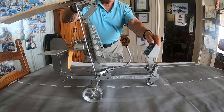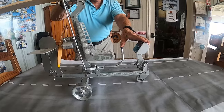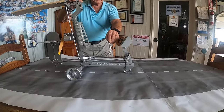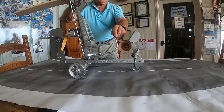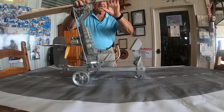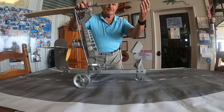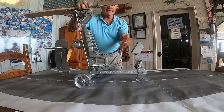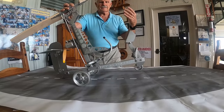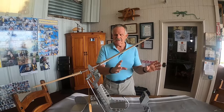It's recommended you don't push the cyclic too far forward, because then the nose is on the ground and you're in an area where the cyclic doesn't give you any feedback — you don't know where you're at. You've got the disc too flat, too much speed, and the rotor blades aren't spinning up like they should. Then the pilot recognizes it, pulls the stick back, flaps the blades, and tips over. That's the second zone where you can get into trouble.